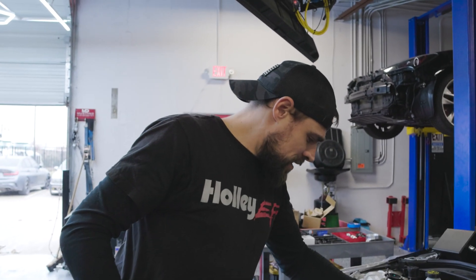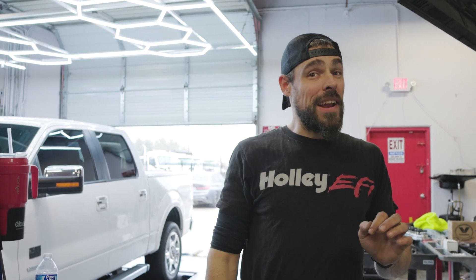What was the final measurement? With measuring for zero lash and the required collapse distance those lifters required, we ended up getting 7.90 — 7.90-inch, 3/8-diameter chromoly pushrods. Do you know what ours were? 7.860. Really? So what's causing the difference there? It's a difference in the blocks, it could be a difference in the cylinder heads, it could be multifactor. The big difference is the lifters, the block, the camshaft. The engine block in here and the factory engine block in RCT-5E have the exact same deck height — I found that out.